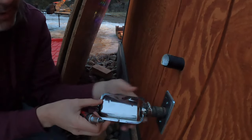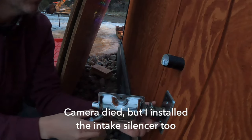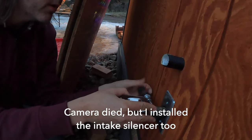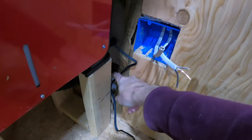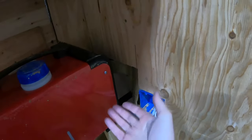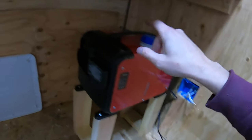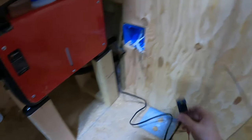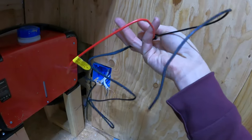Now we just need to install the muffler and air intake. With these mufflers, always point the little crease straight down so moisture can exit the bottom. This is installed, though I didn't totally seal the exhaust, so there's a little air leak, and I haven't framed out the interior of the wall to keep the insulation up. That's okay — this is just a test fire. Wiring is really simple: you just need a positive and negative 12-volt source.